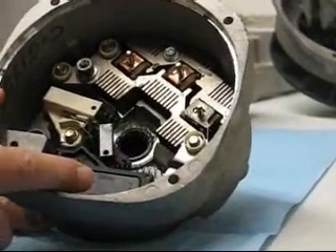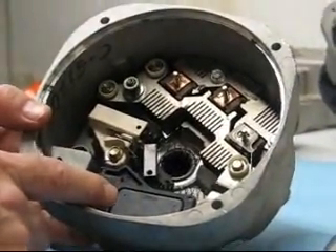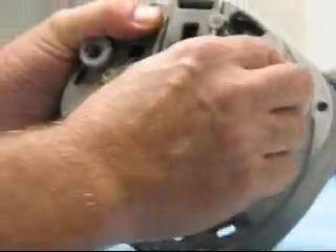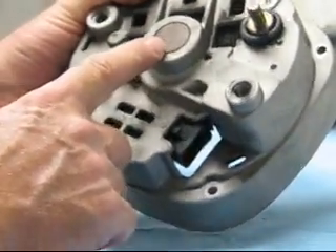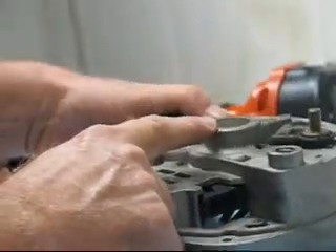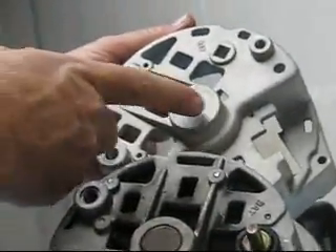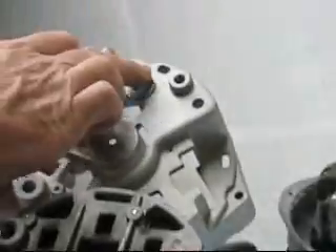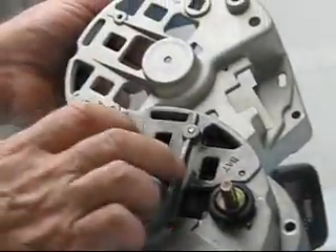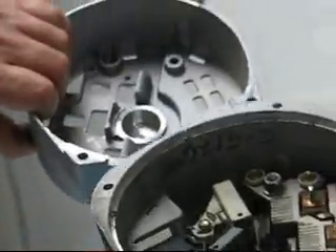Now here's something to note with the CS144. It came in a late style and an early style. This is a late style right here. The reason I can tell is the battery post goes right through the housing here and it's got this metal center, which is the bearing — they went to a needle bearing, which is a much better bearing. The early style CS144 was used from about '86 to '90 depending on the vehicle. You can tell the difference because on the early style the aluminum goes completely over the rear case — you won't see the center metal bearing. Where the battery stud goes, it's a smaller square hole through the case, and there's not as much reinforcing on the early style as there is on the late style.